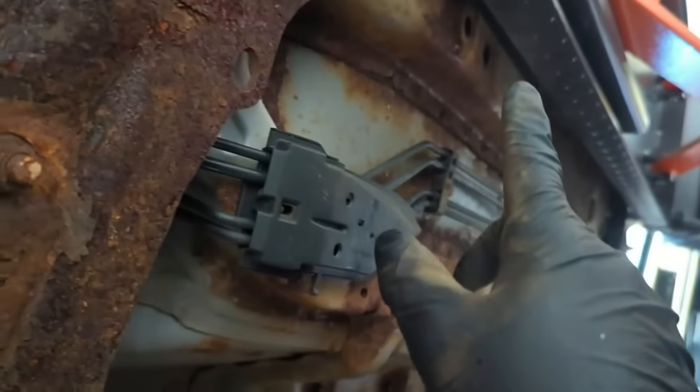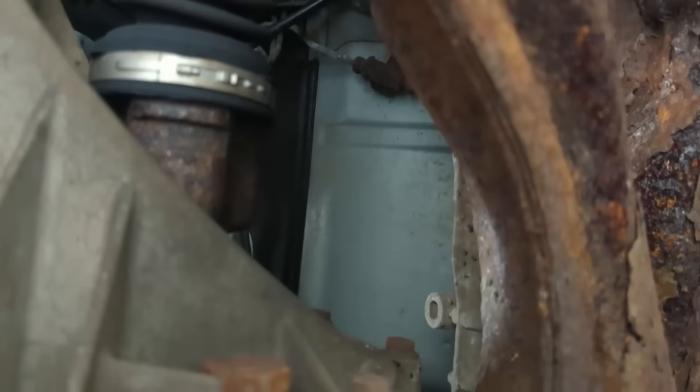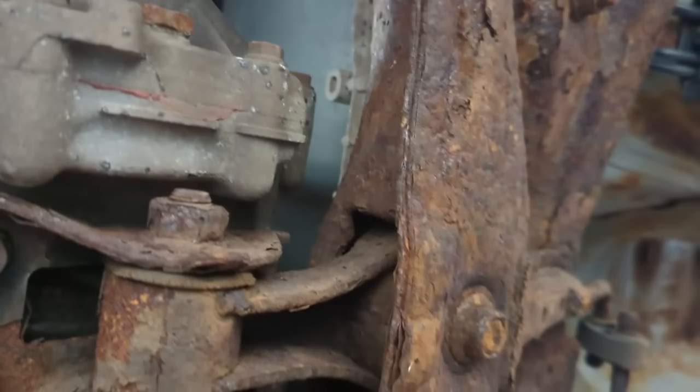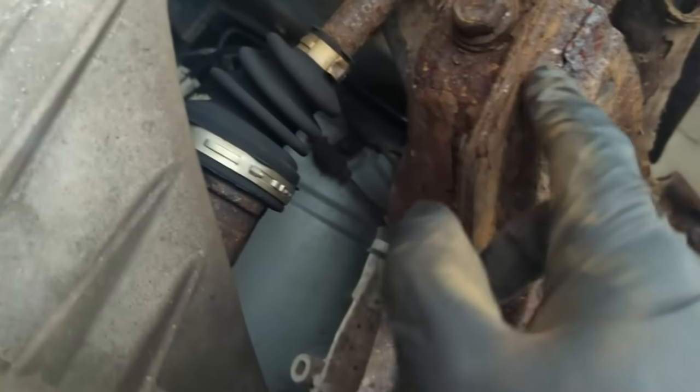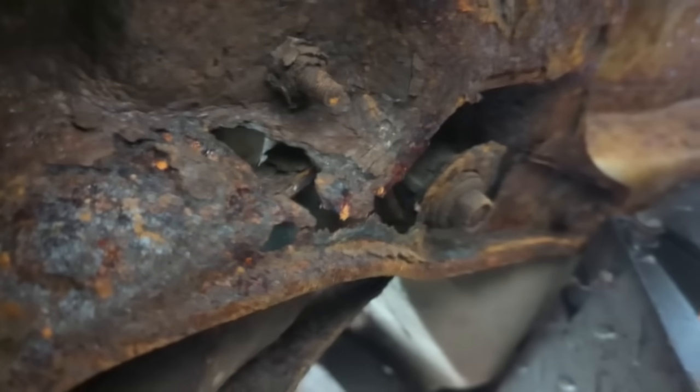Let's have a quick check what the MOT said on this. It's crusty all here as well - none of that is going through the bodywork - that cannot just be wire brushed down and coated. There's only one option which is to replace that subframe. But I'm very interested to see what the last MOT said on this because some of this looks relatively new. This should have failed an MOT within the last two years. That has not happened overnight.